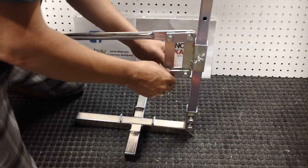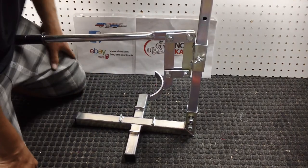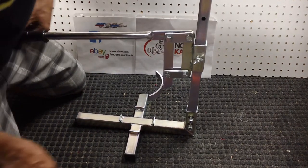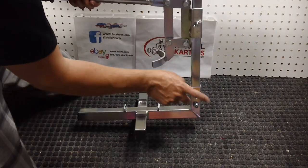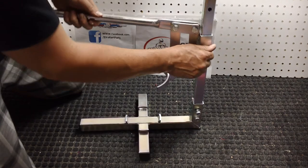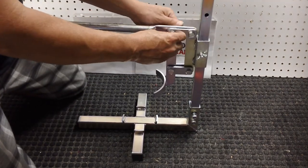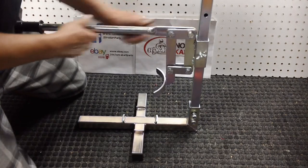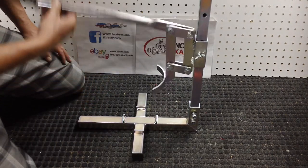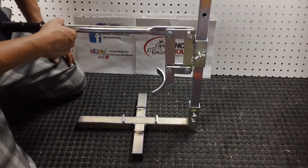The assembly of the RLV TRZ0028 tire bead breaker tool. Again — snug, snug, finger-tight snug. Nylocks are snug but you can still spin the bolts. And you'll have an operating, very easy-to-use bead breaker. Thank you.